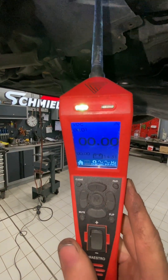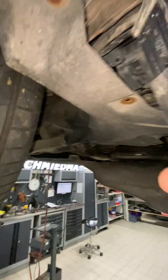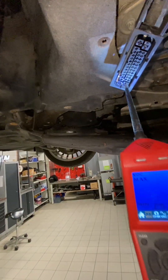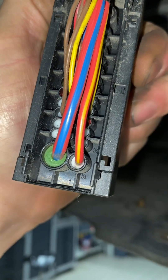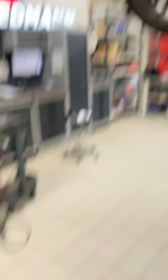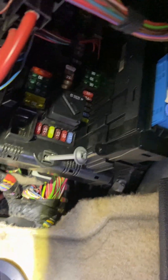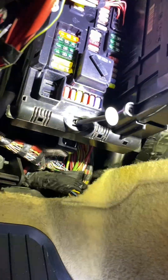Let's check out how I found the fault and how I'm gonna fix it. So pin 25, pin 1's okay. Third power supply is that red one, pin 7. It's dead as a doornail, so that's not good. I'm just gonna go straight to that. Up there — instead of going behind the glove box, which is a complete waste of time — we've pulled the panel off underneath and just up there there's a five amp fuse. You can't see much of it, but I'm gonna test it now.